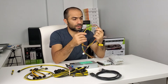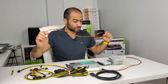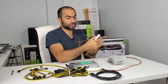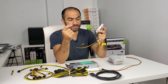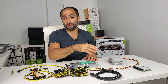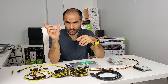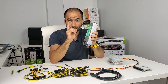Finally, these sync cables come with the breakout boards these days. They're used to connect two PSUs together so that when you power one, the other one powers on at the same time. I'm going to conclude this video and show you my current setup and how I've used them — a dual PSU setup with one regular ATX coupled with a server PSU.